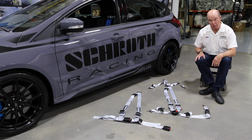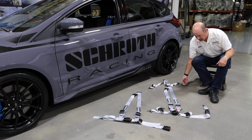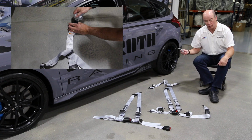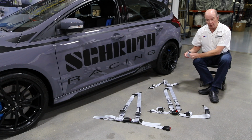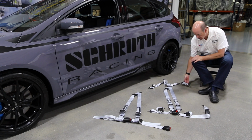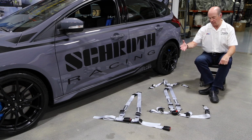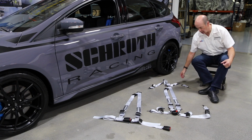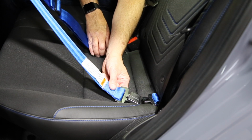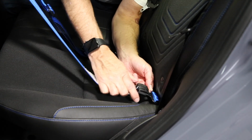In the back, at the rear lap belt, which we call the D and E points, you'll have one piece like this that will bolt in along with your stock seat belt, and all that will stick up will be this little piece. Those two connectors are what will allow the Quick Fit or the Quick Fit Pro belt to be installed in your car in moments. When you want to install the belt, you're just going to click the rear tail strap onto the tail that's installed.